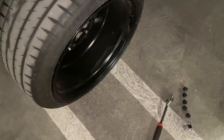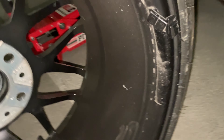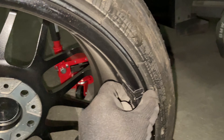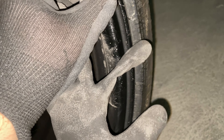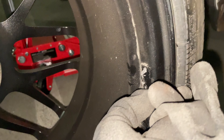When a shop does that, you find a new shop. It's hella traffic right now. All right, so took the first spin — of course it's still shaking. Now I'm going to take the rear spacers off and see if it's a spacer thing. Interestingly, when I take off the back wheels — what the heck — there's a big strip of wheel weights missing. These are going to have to be taken in tomorrow to get rebalanced. Oh my god.